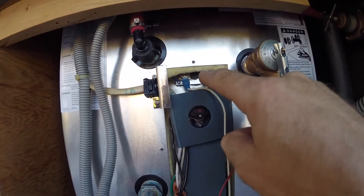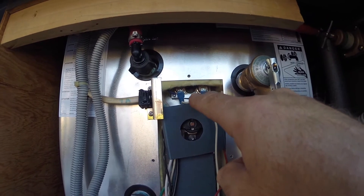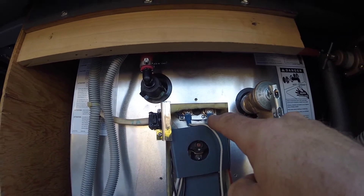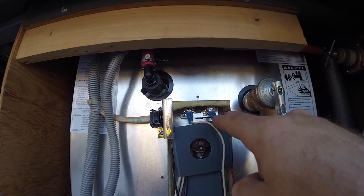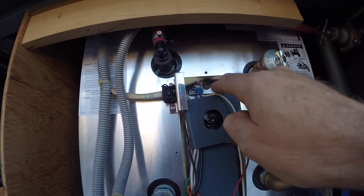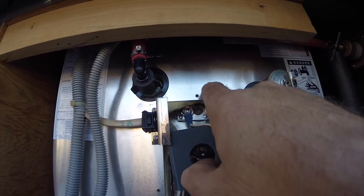What we've done to combat that is we've added a temperature-controlled solenoid into the coolant loop that runs through the back of the hot water tanks. There's a little thermostat that we've JB welded to the front of the tank. That's the thermostat that I found at one of the surplus RV shops. It's any hot water tank thermostat that's 12 volts, and this particular one has actually got two thermostats on it. This one is a resettable one, but I've jumpered over that.